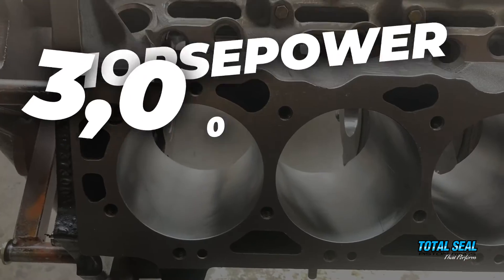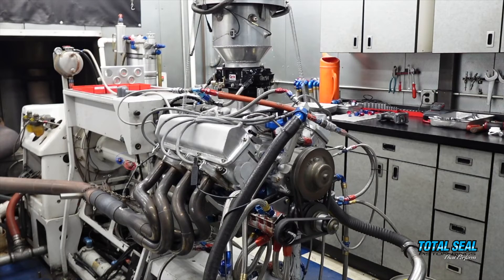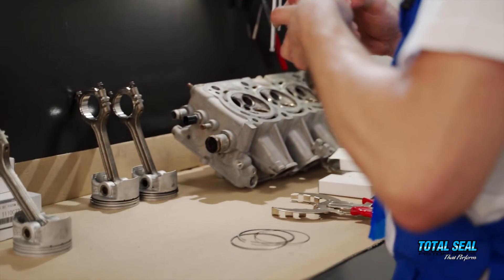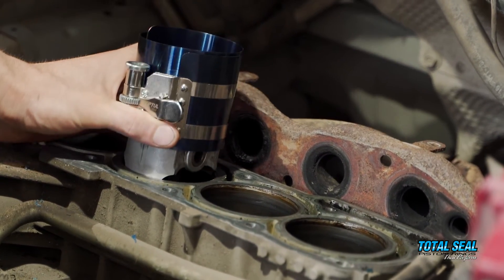That was a gasoline engine. If you have a boosted engine or an engine running methanol, those valleys need to be much deeper. There are some diesel guys out there running compound turbos, tons of diesel, making 3,000 horsepower — those valleys are up to 150. The idea is the more fuel you put through the engine, the deeper the valleys you have to have to hold the proper amount of oil to maintain ring seal. Fine tune your recipe, your ring seal soup, to your application — the more fuel you put at it, the more valley you need.